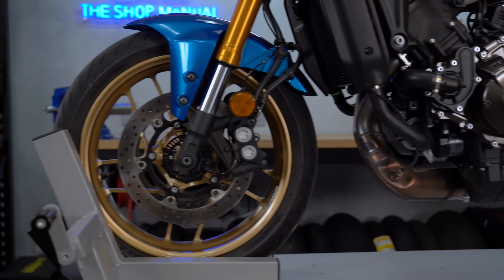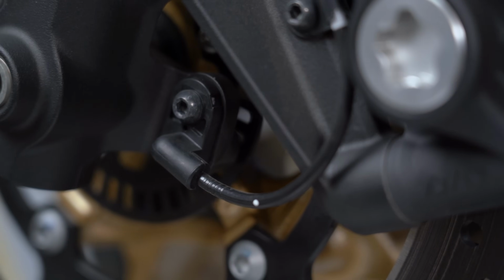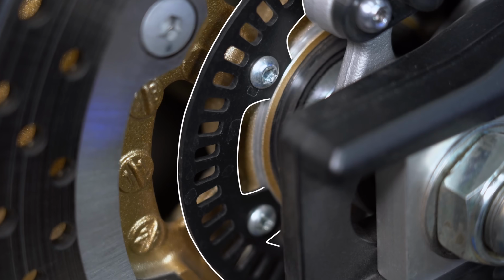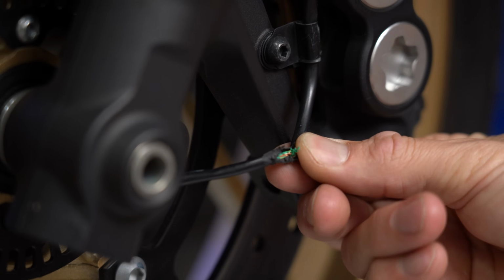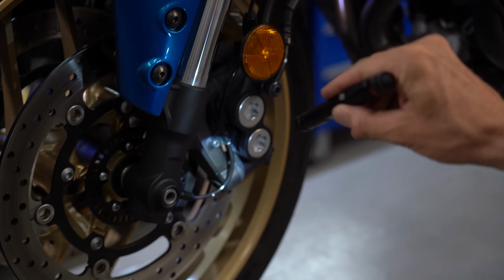First, you should check for hardware issues. Anti-lock brakes rely on sensors mounted on the caliper brackets and tone rings bolted to the wheels to monitor and compare front and rear wheel speed. If there's anything wrong with those components, the ABS light will come on. It could be that the single bolt that secures the sensor is loose. The sensor or wiring could also be cracked, torn, or otherwise damaged. Look everything over carefully to make sure that's not the issue.